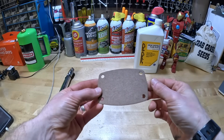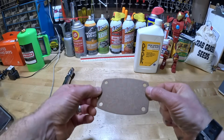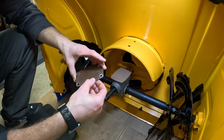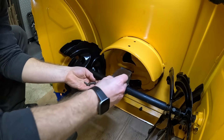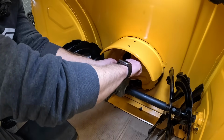Now, to seal this all up, I have a brand new gasket here, and I'll have this link down below in the description. This is the one that matched up with my model number, and I'm gonna place it on just as I found it. Pretty simple here. Gasket goes right up on top. Looks like a perfect fit. And then we're gonna take our cover and we're gonna place that on just as I found it, like that. Next in, I'm gonna twist in my bolts by hand, thread them in, get them all lined up perfectly, make sure my gasket doesn't shift around, which it doesn't appear to be.